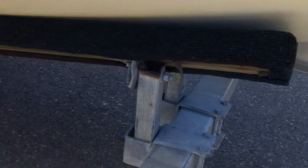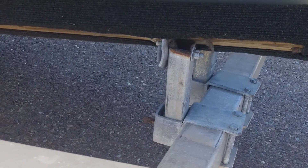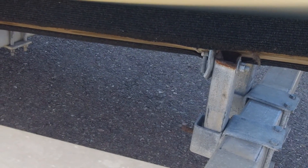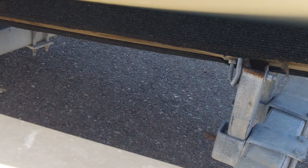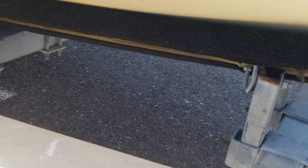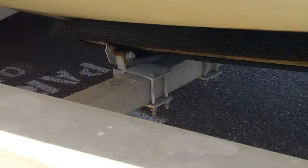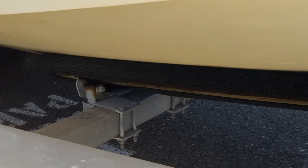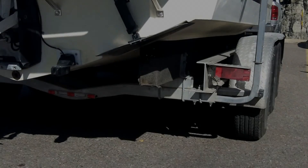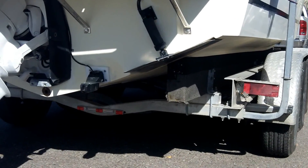The forward bunks look like this. This hardware is available from almost any trailer manufacturer. Basically you're going to have to tweak it — these weren't anywhere near right as far as their shape was, but I've matched them to the shape of the bow as close as I can, and they work pretty well now, as I'll demonstrate when I go to load. Bunk length, height, and positioning are all important considerations.